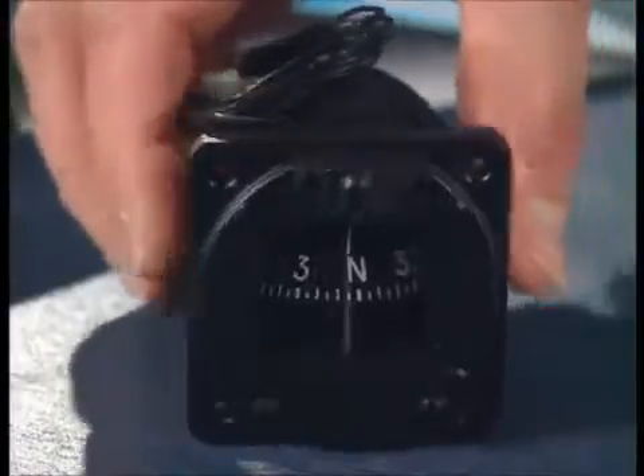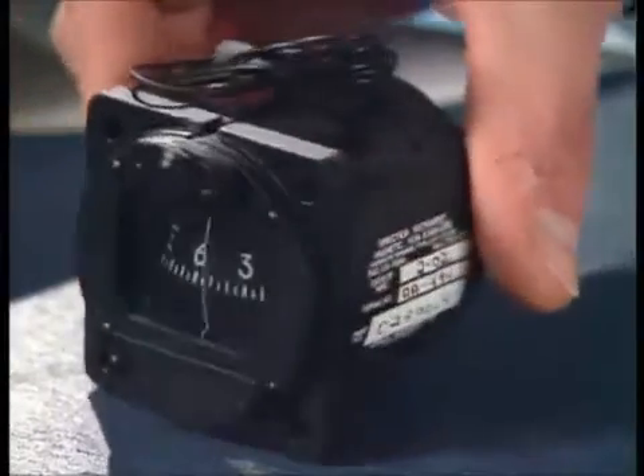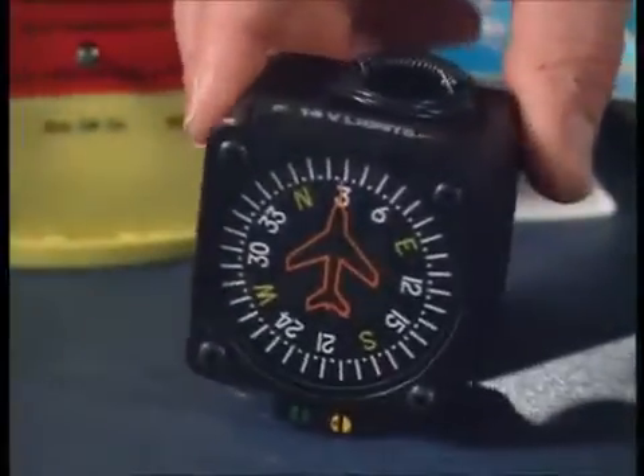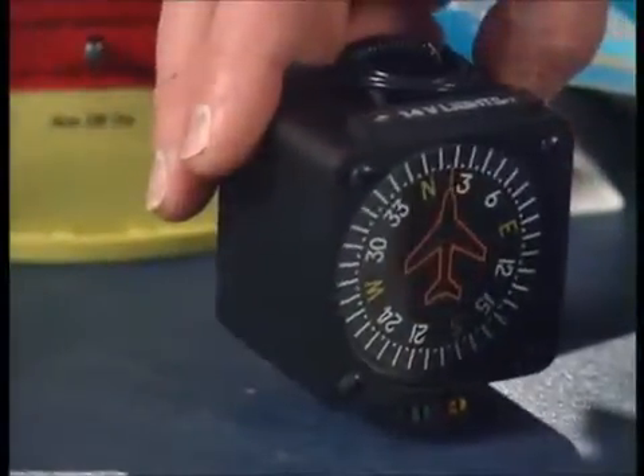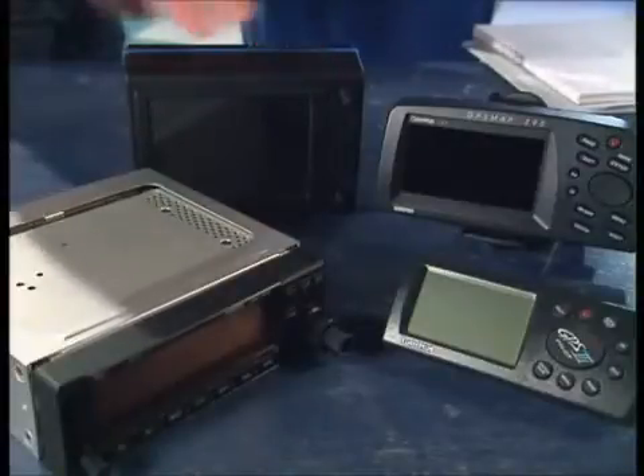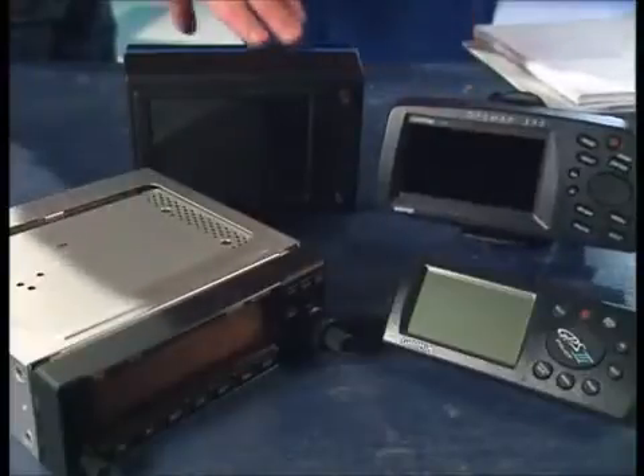Compass. Now there's been a kind of new development in compasses which I've been reading about — explain that. It's not so much new, it's just become more affordable really. It's a better pictorial picture of exactly where you are in the sky, so you're actually looking at your aircraft on a vertical card, seeing exactly where you're going. Last thing — you said about navigation, everybody's using GPS now. What's the benefit over the more traditional VOR type equipment? Weight again is a big issue. It's also much more accurate. 99% of people are using GPS either as their only source of navigation in this type of flying or as a backup.